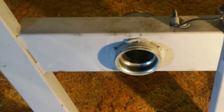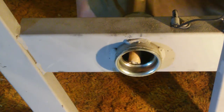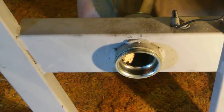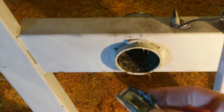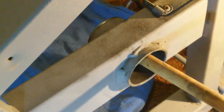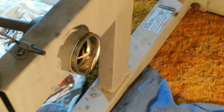Getting the old outer bearing races out can be difficult — they're in there pretty tight. The worst case is simply reusing them, which is probably okay if they don't look bad, but I'd like to replace them if possible. I'm going to try to drive them out with a piece of wood so I don't scratch the metal inside. The right side outer bearing race came out pretty easily, and now I'll drive out the left side bearing race.